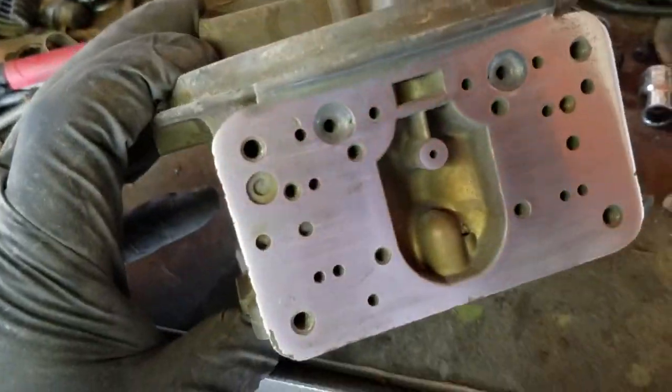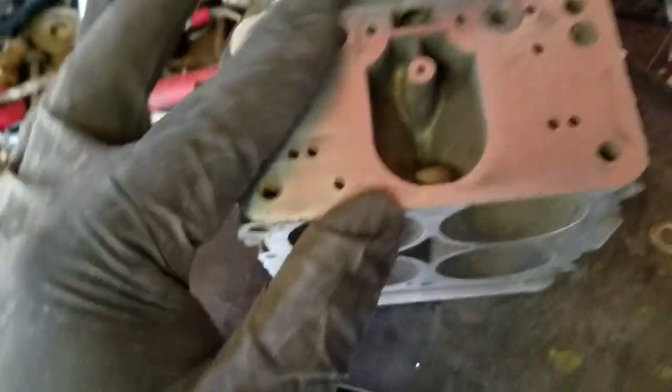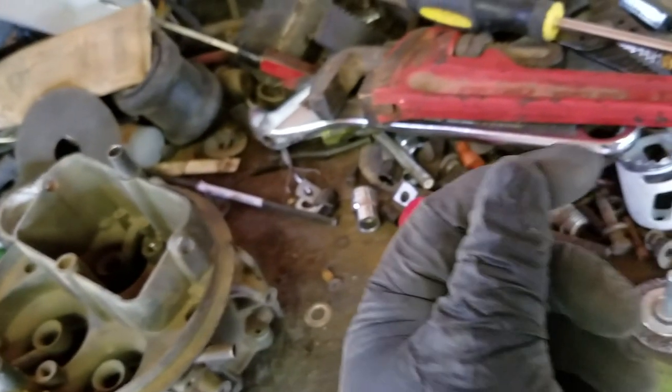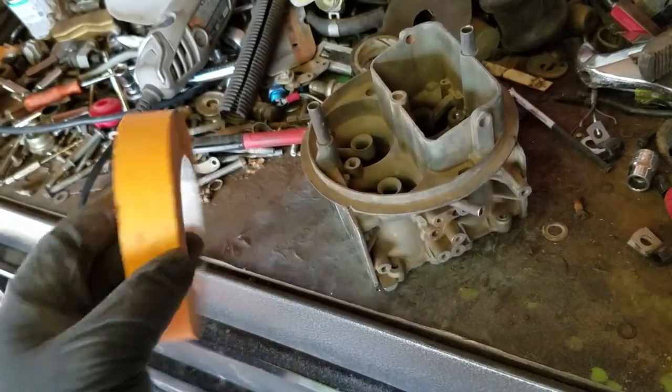The surfaces actually came out pretty nice after sanding, though a little grainy because I didn't do the proper order. If you buy a kit that steps up for you, you should be able to get a nice mirror finish — go in lighter steps, not so many jumps. But overall it's still way better than it was before. Another thing I did was cut off this little tube — these have a tube for ported vacuum that goes to your top hat and closes it when you floor it so hot air doesn't go into your intake. I'm not going to be using it, so I just trimmed it down. Next, I'm going to tape up the machine surfaces and put it in the sandblasting cabinet.